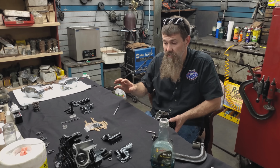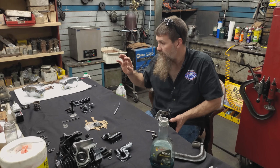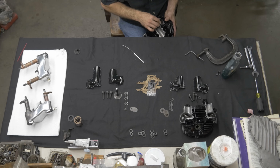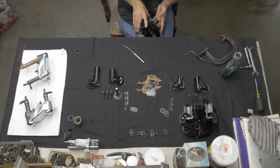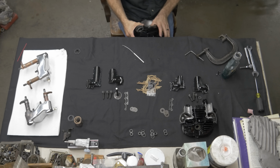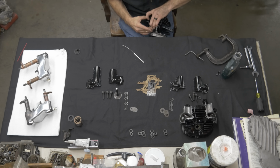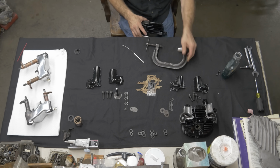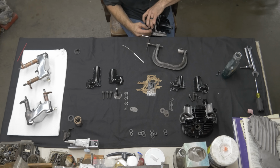Parts that never knew each other. And again, guys, got everything fit really just how we like it. So it's coming together really nice. Lapped in the valves yesterday and blued the seats, made sure everything was sealing and seating properly, and this is going to be one sweet top end.